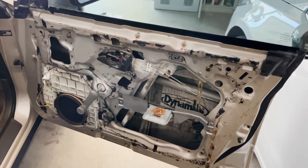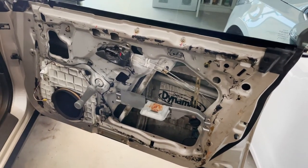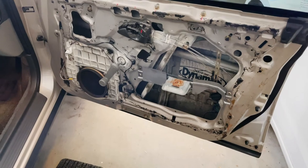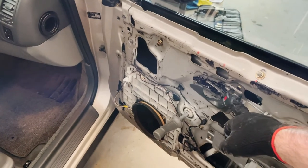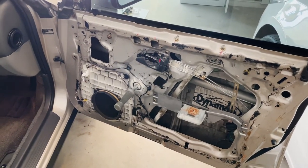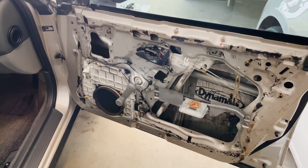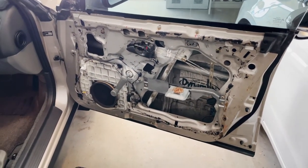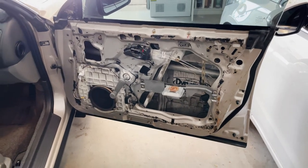I'll just replace the door trim and all the other bits and pieces — it's just a reversal of what I showed you earlier. When you put the door trim on, just give it a tap around the perimeter to get those clips seated. And don't forget — be very careful installing the door cup. They're very fragile, I've broken many over the years, and they're hard to get and expensive. Hopefully this has helped you out if you ever need to replace your door handle or remove and replace your door trims. Any questions or comments, leave them below, and as always, thanks for watching. Cheers.